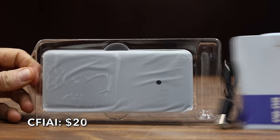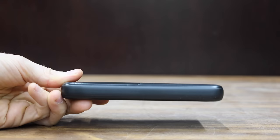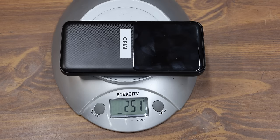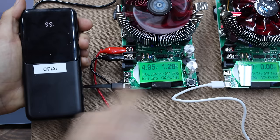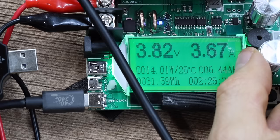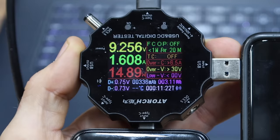Also at $20 is the Safia brand — a 15,000 milliamp hour fast-charging portable phone charger. It has a built-in iOS cable and a Type-C cable supporting almost all smart devices up to 22.5 watts. The Safia is made in China and weighs 251 grams. The USB-A port performs about as well as the Keol at 17.72 watts. The built-in USB-C cable delivers about 16.41 watts, and the built-in lightning cable performed almost as well at just over 14 watts. The USB-C in-and-out port made it to almost 15 watts — about 5 watts less than the Keol and Inu.